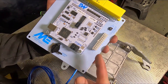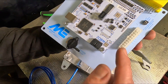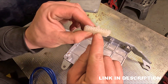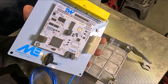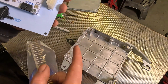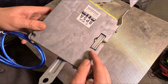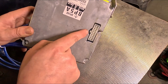This big plug on the side is the options port, and this gives you more options such as additional injectors, running the two extra coils, and some other cool features. Now I don't know if I'm going to utilize all of those, but I definitely need a few of them, so we need a plug that goes in that. For the ME221 Generation 2 board, you have to purchase yourself a 5557 20-pin male connector block which plugs in nicely to the options port. I've cut a rectangle hole into the frame as the options port plug sits pretty much flush up against the box, so now I can put all my wires into the option plug. I cut a little extra access here to release that tab.